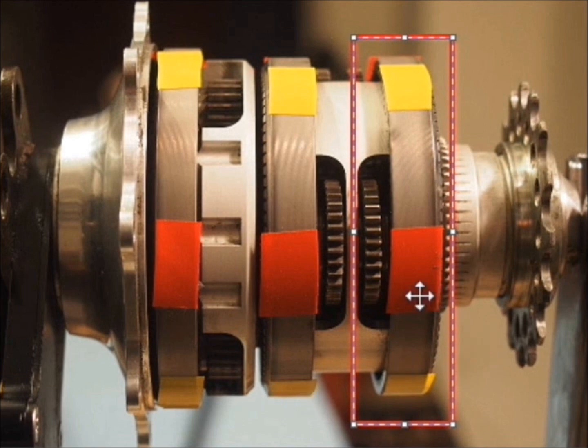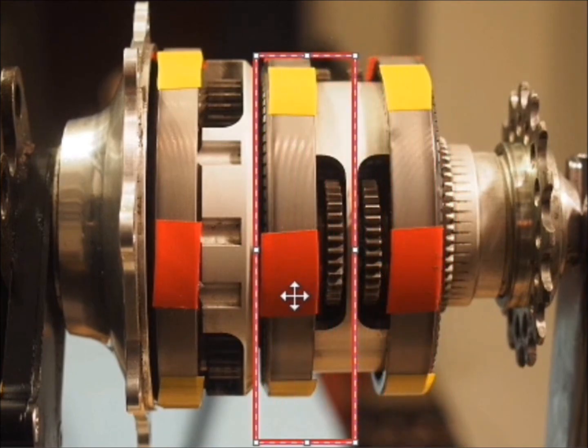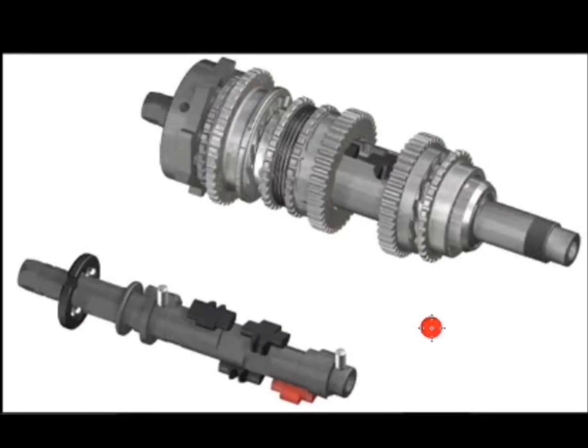The seven speed stage can be further divided into two stages, with two sun gears and a step planetary in each stage. The input end of this stage provides two speed reduction ratios or direct coupling, and the second stage provides two overdrive ratios, also with a means of direct coupling. The shifting action is accomplished by rotating a shaft within the hollow axle, causing four engagement pawls to rise and couple the four sun gears in the primary stage to the axle, one or two at a time. There are also four clutches which are engaged and released to couple units together in direct drive mode when required. We will look at which pawls and clutches are engaged or released to accomplish each gear. The shaft will make two complete rotations through the shifting sequence from 1st to 14th gear.